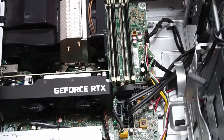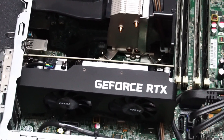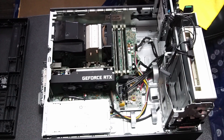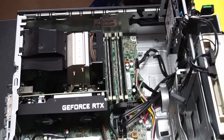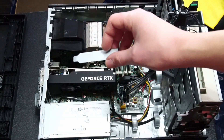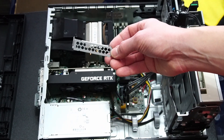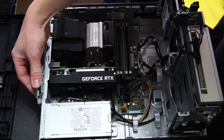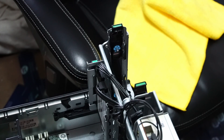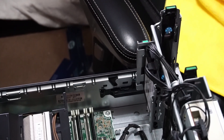That's looking pretty good. This RTX 3050 doesn't require a PCIe power connector, which is why I chose it for this PC. I got a pretty good deal at about $200 Canadian off Amazon using discount codes, and the PC with the 4790 was donated to me — shoutout to that guy. So I'm mainly paying for the SSD, the RAM, and the graphics card. The HP came with flat metal brackets for the PCIe lane covers, but I'm using some honeycomb grill brackets from a Lenovo SFF for passive air cooling for the GPU. We could fit an extra hard drive but I'll leave that for the customer. It's good to know we have expansion options.